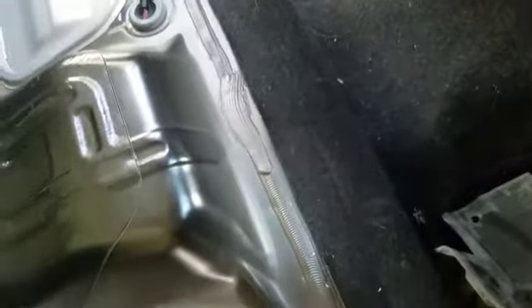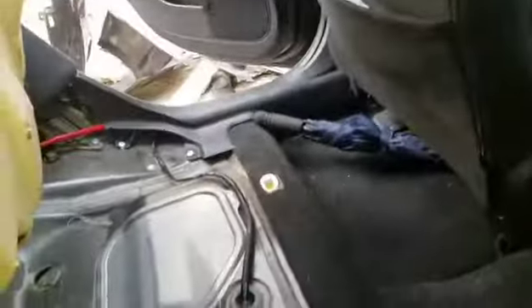Once you flip your back seat up, you want to go to both sides of the car and grab from right here and pop it up. As you can see I already did it on both sides — they're clips. It's easier to just open the door and go to the other side. Pull real hard — don't worry, nothing will break. It's like a clipping clip, so just pull up real hard and both of them come up.